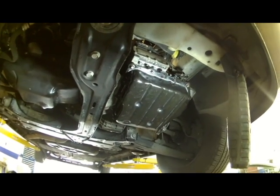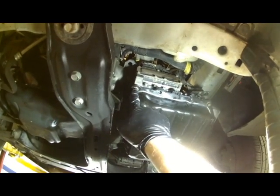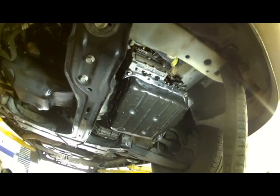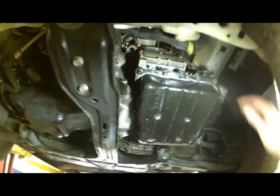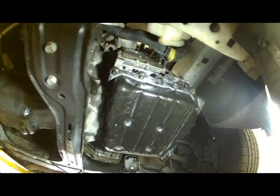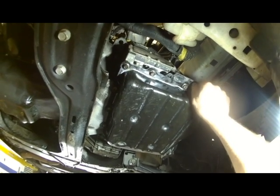Alright, so of course, yes, we snapped our filter into place. We got a gasket with our kit, so we got the rubber gasket in here. We have it held in place by 4 bolts, which we started by hand and put it up there. So we're just going to go ahead and finish installing the rest of the bolts, left to loosen, right to tighten, and then we'll torque them down. So we got our bolts tight. They're only 6 Newton meters or 50 inch-pounds, not very tight at all. So snug them down, put our nut on here, and we'll drop it down and add fluid.